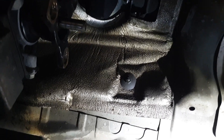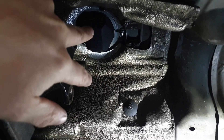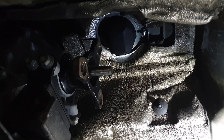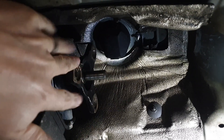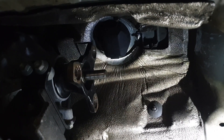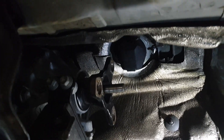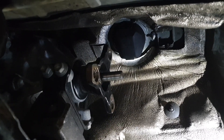At the back here we've got our prop shaft flange, and that's our automatic shifter just up above. I've got the Lexus prop shaft and the BMW prop shaft off with a driveshaft company now to get them to make it the right length for me and to put the Lexus front end basically on the BMW prop shaft. Once we have that in, all the work underneath the car will be done and I can let the front down and start wiring up the inverter and the VCU and get a bit of cooling on here.